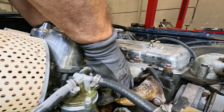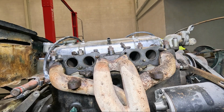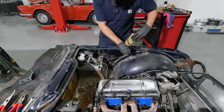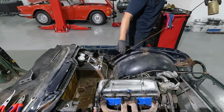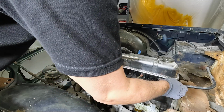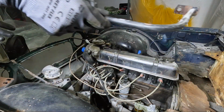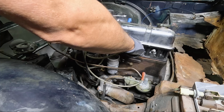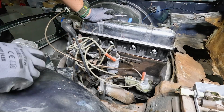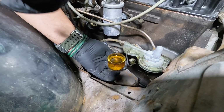Well, I'm making it look easy there because I've obviously removed all the bolts, which I thought were going to be difficult to take out access-wise, but actually the access is not too bad. The last of the wiring loom that goes down to the starter, the windscreen washer bottle and the hose, the water hard pipe that runs around the back of the engine, that could actually stay in, but I've removed it just to give a bit more clearance to the bulkhead, and also I left in the throttle linkage because mine's rather bent, and so I figure it's going to be easier to remove that once the engine's out of the way. The distributor and the leads, in theory that could stay on, there's enough clearance, but I imagine snagging on a lead, so I removed that as well.